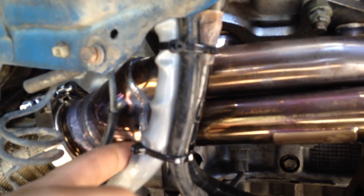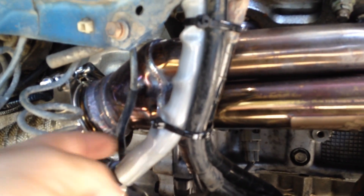On this side the exhaust comes down. The fuel line is wrapped with a heat shielding material — I just kind of draped it over it; it's supposed to keep it nice and cool. I've also wrapped the pipes where they're close to the brake lines, and it seems to be doing the trick.